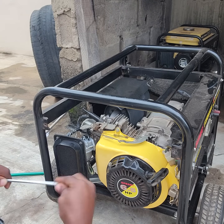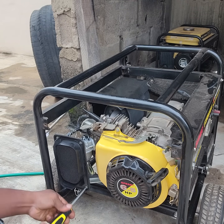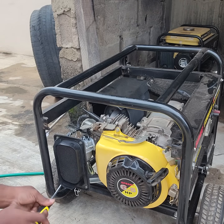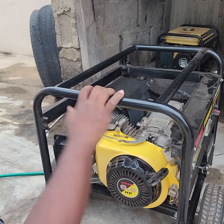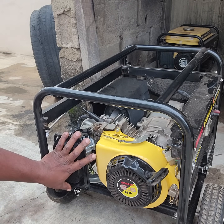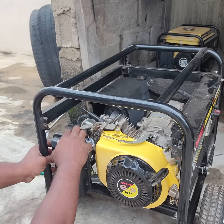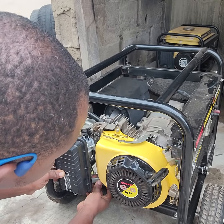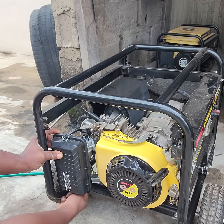I've been using this generator for over eight months now, using petrol. I calculate my usage - one liter of petrol lasts about one hour 45 minutes with minimal load. Now I'm going to put the cover on. Also, don't forget there is a prong that comes out with a screw that holds it at the back - you have to put that screw at the back too.